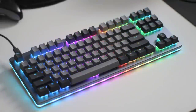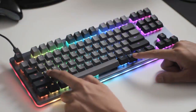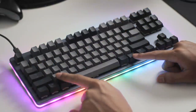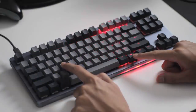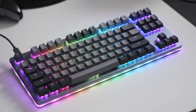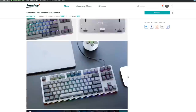We can control the lighting on board via the FN key, and on the card we got in the box, it tells us all the controls. So by default, everything lights up, but we can change it to just key backlighting or to just side glow lighting as well. There's also some media controls that aren't labeled, and we can toggle between 6 key rollover and N key rollover. However, all of this can be customized as the keyboard is powered by the QMK firmware, which is the firmware that's on most custom mechs. But QMK can be a bit fiddly for people as it isn't like a normal piece of software where we can just apply these things. Rather, we configure everything first and then flash it onto the keyboard, which is annoying, but the advantage is that it's quite powerful.